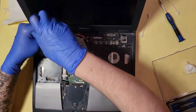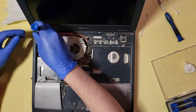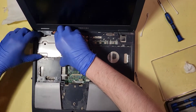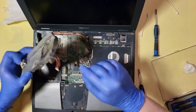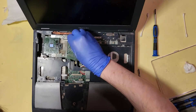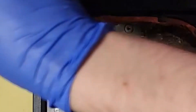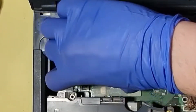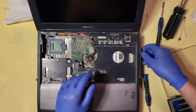There are four screws holding the fan in. The fan could be removed — it was connected with a little cable to the motherboard, which was pretty easily removed. As you can see, it was very dirty. Then I had to remove the CPU. I cleaned around the CPU a little bit. There's a little latch that I pushed, and this took me a while to figure out — you had to kind of nudge the screwdriver in there to pop the CPU. Then the CPU could be removed. It's an Intel CPU, pretty common — I think it's a Celeron. Then here comes the CD-DVD drive.